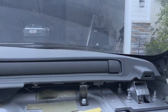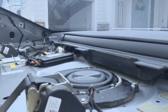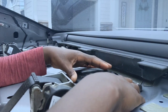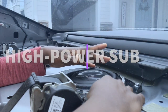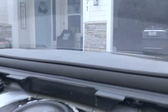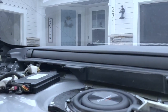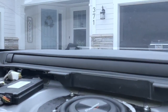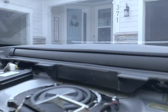So now this is it. In my case I did take out the speaker because I wanted to install a 10-inch sub in the back. I managed to install the subwoofer, but the problem is this was not meant for anything heavy. You cannot put a subwoofer here that puts out a lot of power — it's going to be vibrating everything. If you were next to me right now you'd probably be smelling a very bad smell coming out of this Pioneer 8-inch shallow woofer. That one is toast — it smelled terrible.